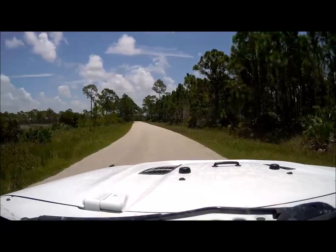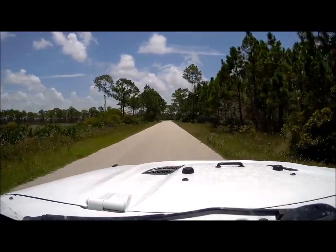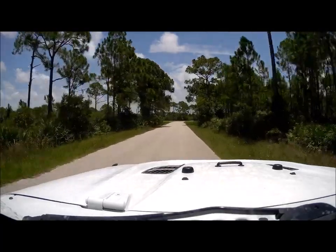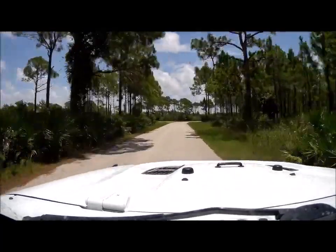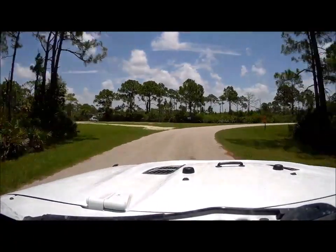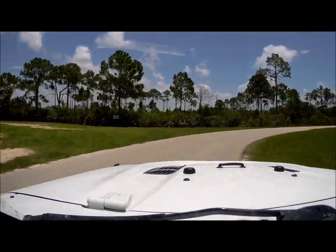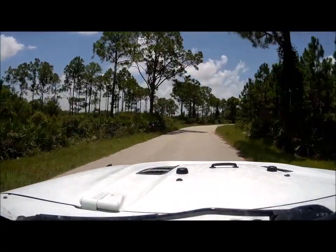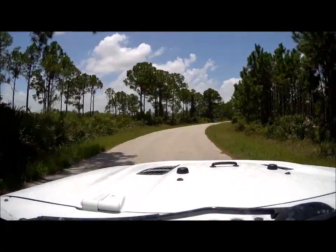The electrical connector is just mounted in a bad spot, and it's almost horizontal in there. So you would think, but powder gets everywhere. So I ended up cleaning the connections really good and threw a bunch of dielectric grease around it and sealed it up really good, and it seems to be holding. That was within the first few thousand miles it happened.